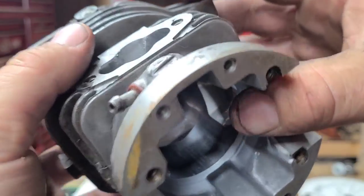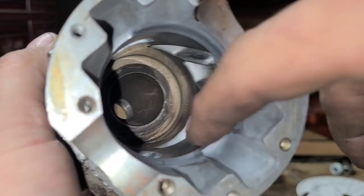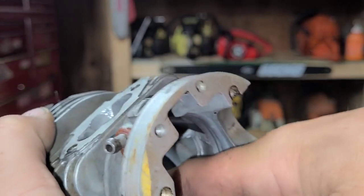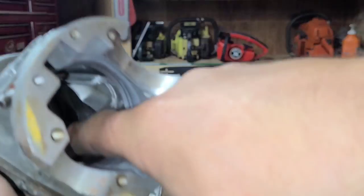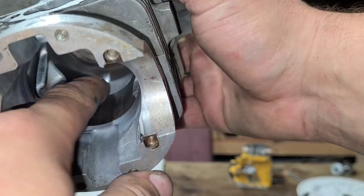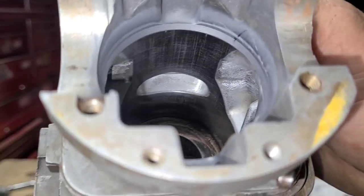Most important thing when you port a cylinder: see how there's a small lip here? It is of the utmost importance when you port a cylinder to run your finger over there — your big finger — and make sure it's like glass. I use 600 grit and I put my finger in there and polish it. You want all your surfaces polished. Same thing with the transfers, otherwise you will rub big marks in that piston right away the first time you run your saw.